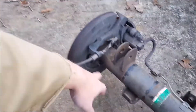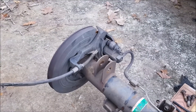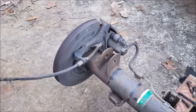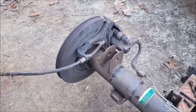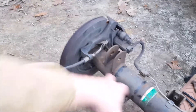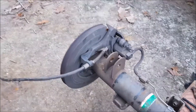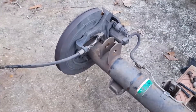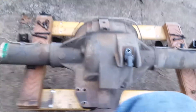The backing plate is still going to be in the way, so I may take these four bolts out and get the backing plate off. But I really don't want to have to take the axles out — there's no need for what I'm doing. If I can't get to it without removing them, then I will take these four bolts out and take all this backing plate and dust shield off in order to get in there. But I think I can probably get to that without doing that. I still have four other brackets I can take off prior to doing that.